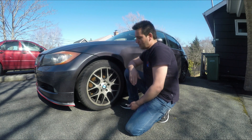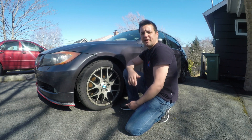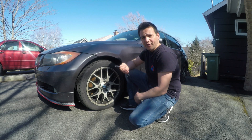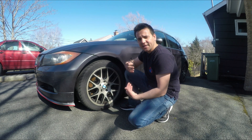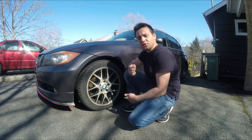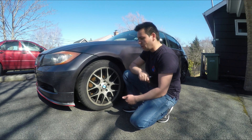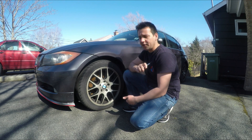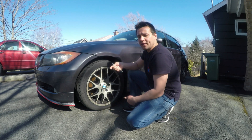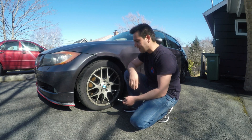FTMS stands for Flat Tire Monitoring System and it's run by the ABS sensor. While you're driving, if one of the tires suddenly has less air pressure, the rotation radius on that tire is going to change and trigger the ABS sensor, which means you're going to have the TPMS logo on the dash. It is not as accurate as a true TPMS because it could be a lot of things, but it's a warning so you should pull aside and check what the problem is.